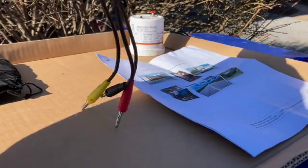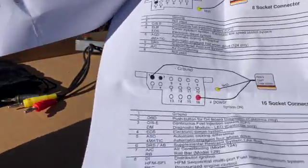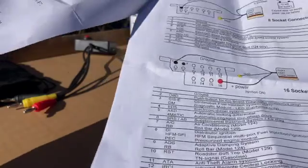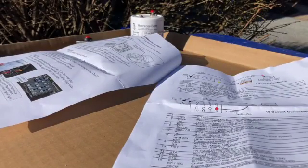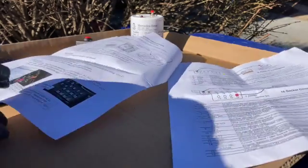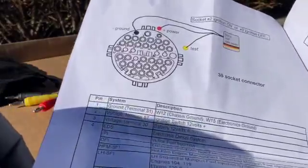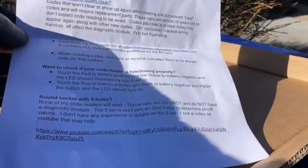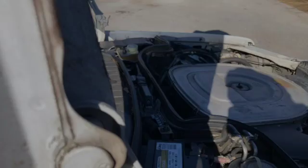There's the LED and the connection wires. It works on the 8 and the 16 diagnostic pin type plugs that you have on the various 126 and 124 cars. It also works on the 38-pin connector. There are plenty of descriptions — he put all the codes that you can possibly get into under MyMercedesCodeReader.com.